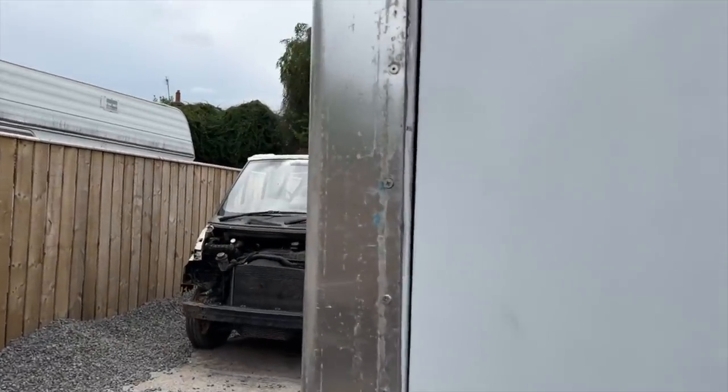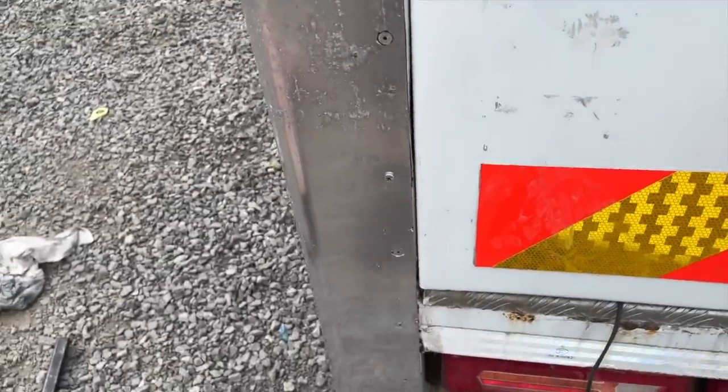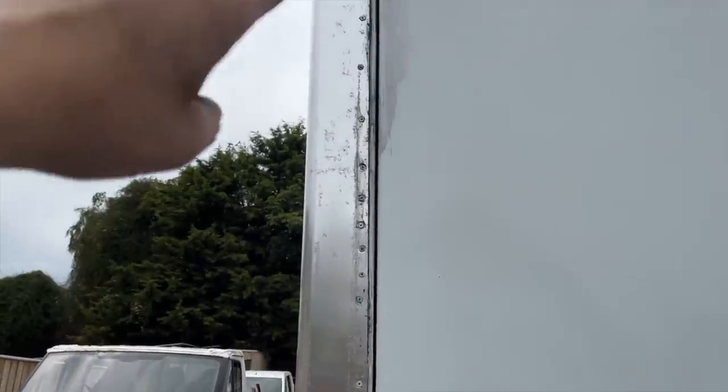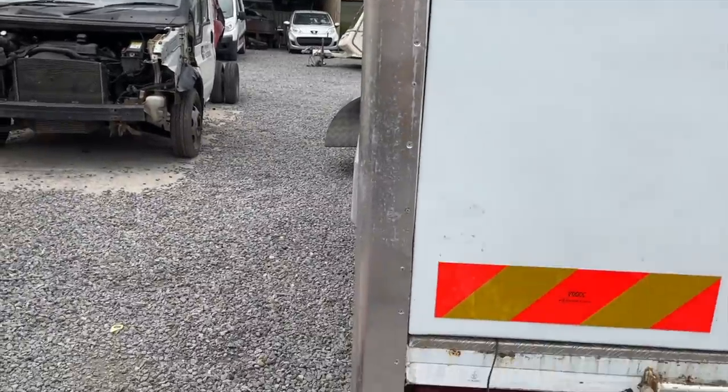I might be able to see it a bit closer. So this, and it runs off. See, it's running off to nothing. Don't like it. So we're gonna make a nice line up there with the grinder and the slitting disc. And then we can put a bead of sealer in there after we've filled this and sorted this out. I've had to put a few more screws in there to pull it round because it's really lumped up tight there. But filler hides a million sins.